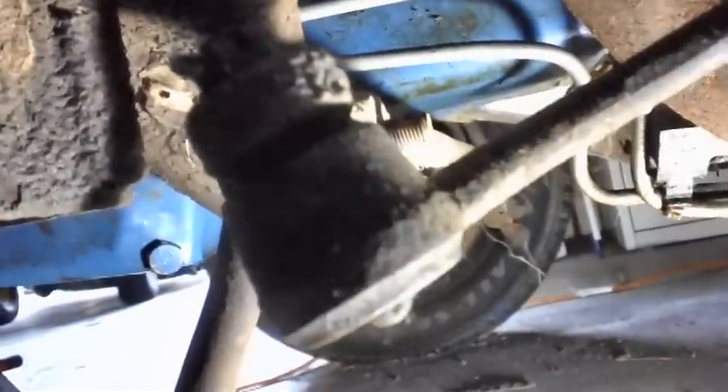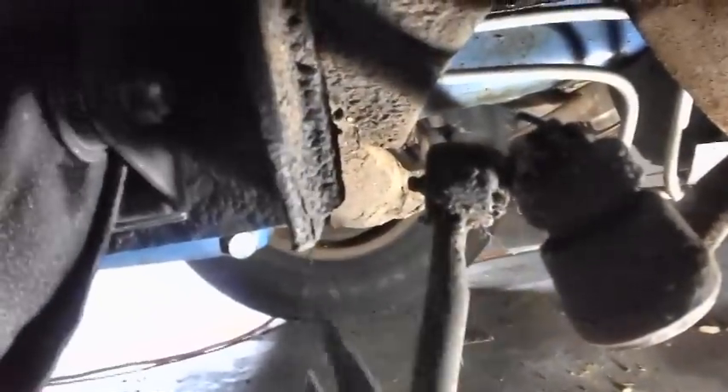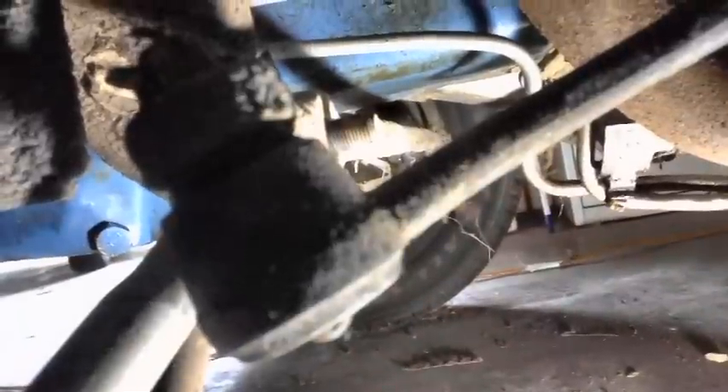She just broke loose — get that baby off of there. First I cleaned it out and cleaned all the dirt off around it with a wire brush. Makes life a whole lot easier — your wrench will fit on better and you won't have any more difficulties. Got that cotter pin out. Now all I have to do is take my little wrench and put it on the other side, then hit it with my ball-peen hammer and the entire thing will separate and come down.